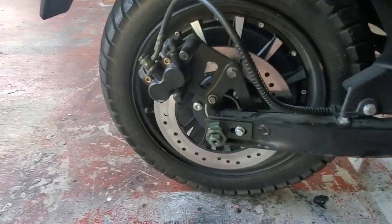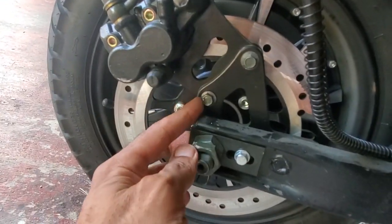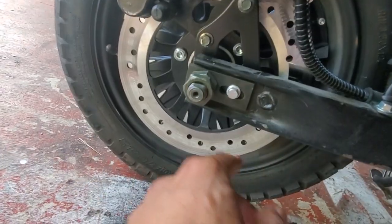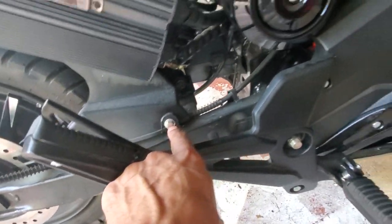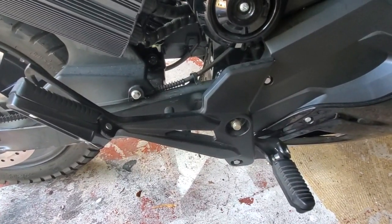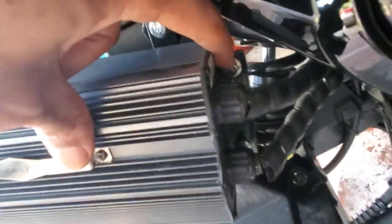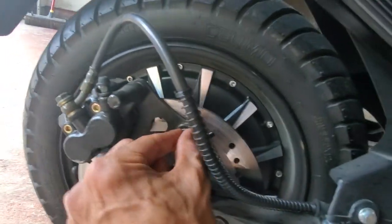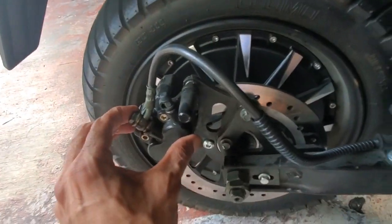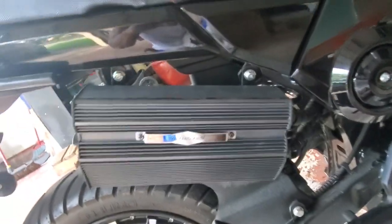You have disc brakes — I did not go over that. Some of these will be loose when you get it. What I would do is go over this bolt, this bolt, make sure this is locked, go over this bolt, this bolt, this bolt. If you want to be safe rather than sorry, yes, go over every bolt — especially this one. Make sure they are really tight because you don't want any play when you have your brakes engaged; the sound and vibration is just nasty.